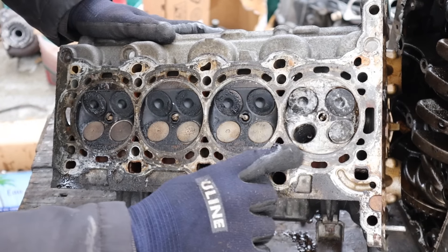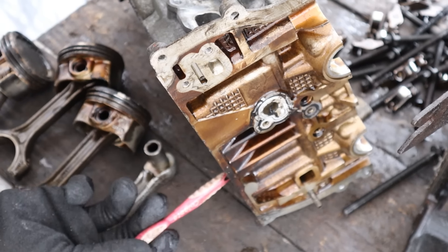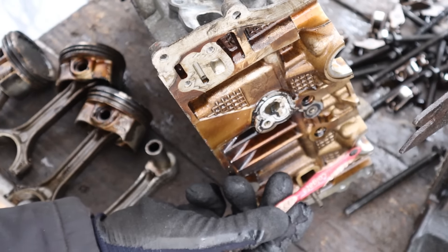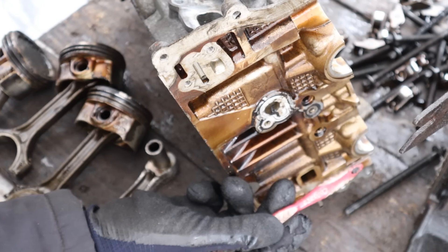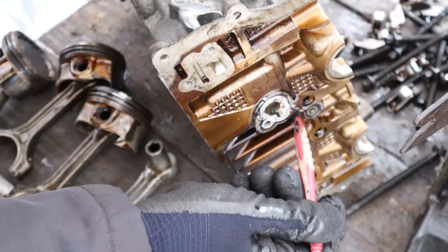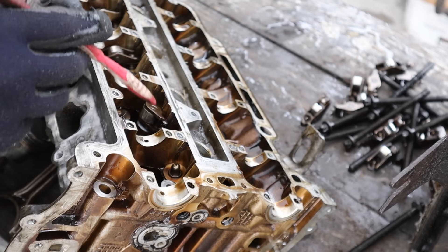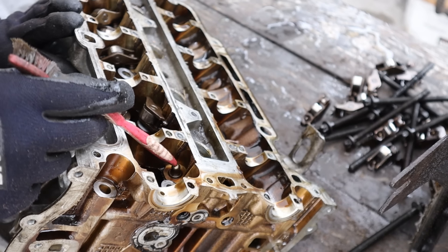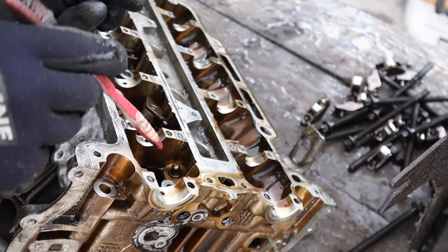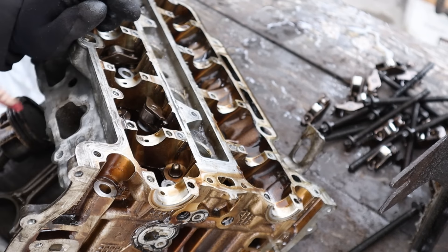I can actually see a crack right here. Now finally at the front of the head here, you'll see that we've got the oil feed that comes in here, goes up and then across to feed the two cam gears for the variable valve timing. It's also going to feed these two ports here which run galleries along the length of the head. The oil is going to run along the head so that it can build up pressure for your collapsible hydraulic lifters, and also these cam gears need to feed off of that so they can get lubricated as well.